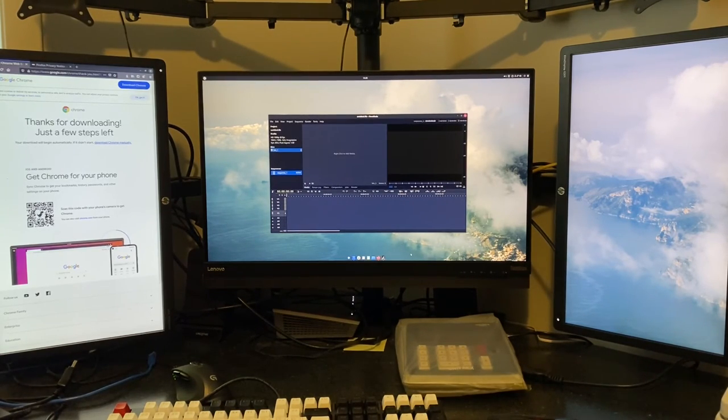Everything just works perfectly. So anyway, if you need more displays than what you can do with just one video card, the best thing, honestly, is to get a burner card and stick it in another PCI Express slot if you have it. That way you have more display outputs. I can actually do that with this machine. If I wanted another 3 display outputs, I could put in another card and do that. And who knows, maybe in the future I will.